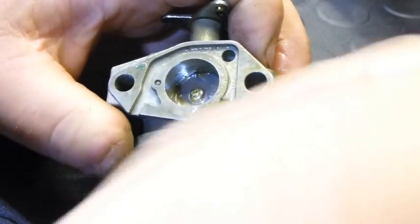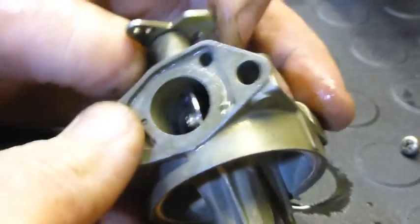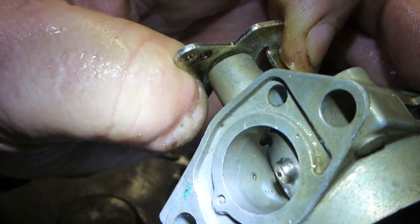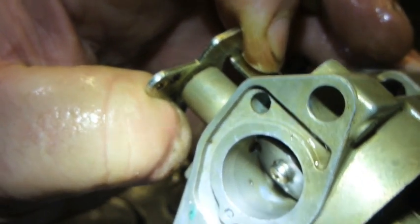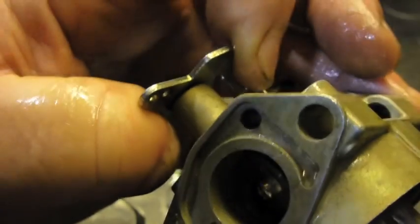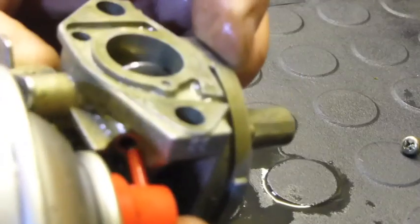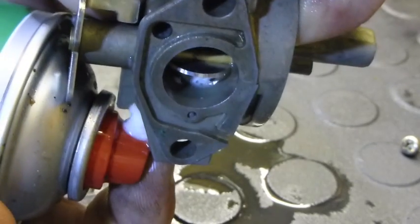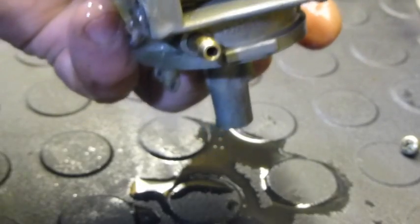Now the idle screw — the mixture screw, this one with the point on it — works through this hole. There's a tiny little hole down in there, just under the bottom, about 10mm back in, and then a series of three little holes just behind that. Those are the idle speed mixture holes. When you screw this one, you alter the amount of fuel that comes out through those little holes, and they've got to be clean — otherwise it won't work. They do get blocked from time to time, causing an inconsistent idle. You can see the cleaning fluid coming up through those holes. So that's all nice and clean. Then we just reassemble, and that's the job done. Hopefully when you put that back on, it'll work.